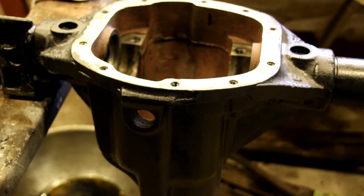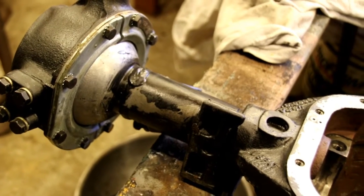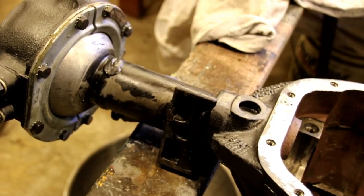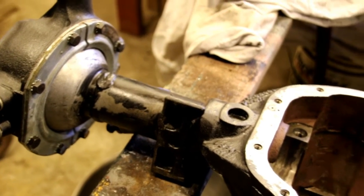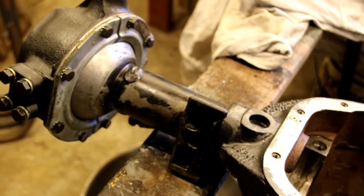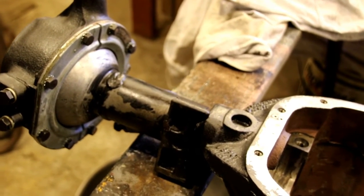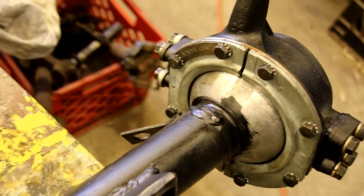We're going to get this front end ring and pinion set up today. If you remember last time on the front end, I've got the knuckles on and the preload set. Since then, I've got the original style knuckle wipers on there — this is a new old stock set, a cast aluminum part with a rubber seal inside of it and a gasket on the knuckle. They look very authentic. What you find now is a stamped steel piece with a rubber and felt, and they work okay too, but a customer was able to find these so we used them. We've also got our tag on there specifying it's a Bendix joint.